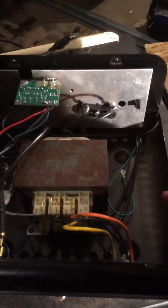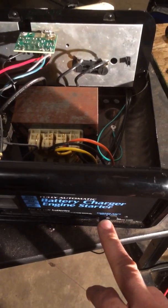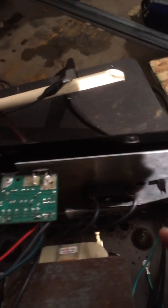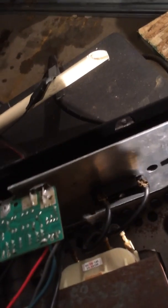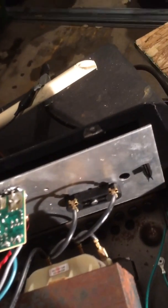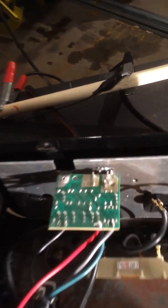And now you've really simplified this whole battery charger. You got your AC power 120 coming in, you got your selector switch to choose which set of coils you want on the high side of your transformer, which will choose your 2 amp, 10 amp, 50 amp. AC power coming out on your lines, it's going to go through your diodes to change it into DC power, and out it comes the other side. You check out all the smart stuff — that little tiny board — it's not really that smart, it's kind of simple and basic.